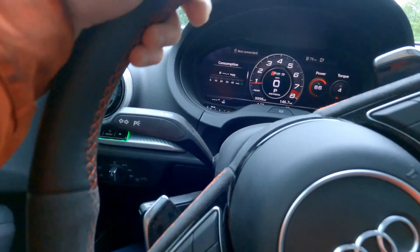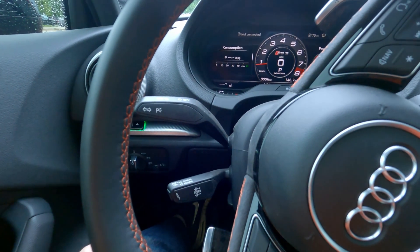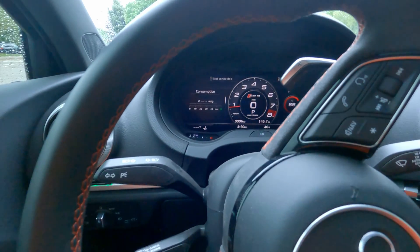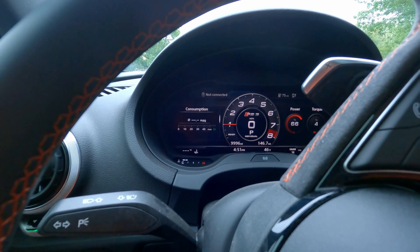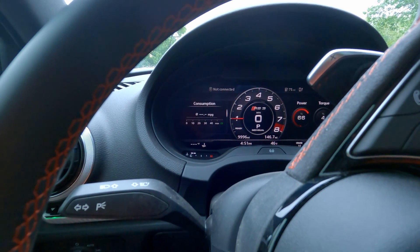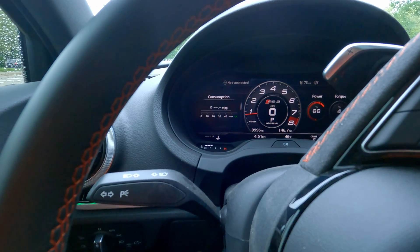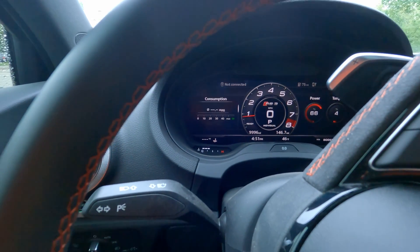When you are doing map switching — if you're already on, which is usually how I'm driving the car around — you hold forward into cancel, your check engine light flashes, and this is your map switching: zero, one. Kyle from SRM is giving us two maps to try out right now while we're dialing in boost, so I go to map one as directed by him. Both of those maps are flex fuel because we are running an ethanol content sensor.